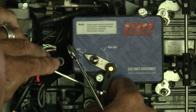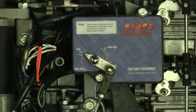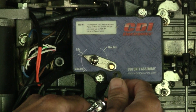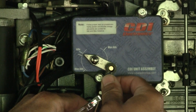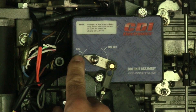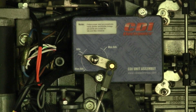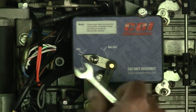I take a 10 millimeter and gently pop it off. The timing was somewhat retarded — right about there. We want to adjust it so it's between the two marks, which puts it at seven degrees after top dead center. I'll move this out to get it right in between those two lines — that's the adjustment for seven degrees after TDC for retarded timing. I'll use a nine millimeter wrench to hold it steady while I tighten it.